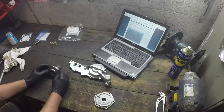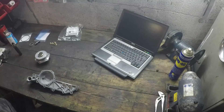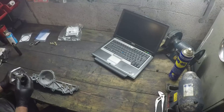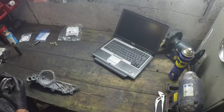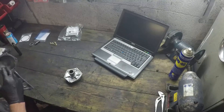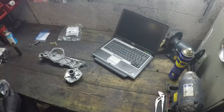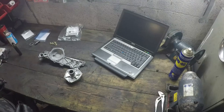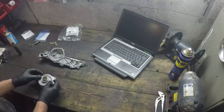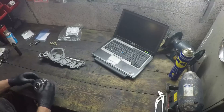So I'm going to go ahead now and put the seals in the outside and then we'll assemble it in the piston body. Once you're happy with your piston fit and the amount of play, you basically need to take the whole thing apart again and assemble it in the actual piston body itself, so that you've got the whole thing put together as one unit ready to go in the housing. I've had to clean up the interior of this housing because I grit-blasted the inside of it, so I've just smoothed the surface off a little bit. Now we'll grab the seals — it's really warm today so I'm hoping this Teflon seal doesn't have to be stretched that much. We take the first o-ring, put it in the groove.